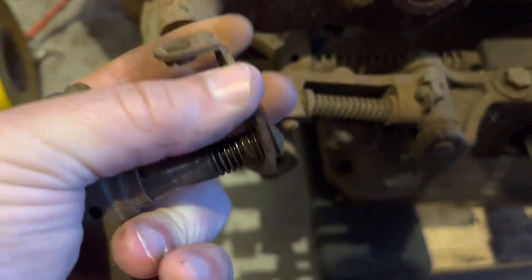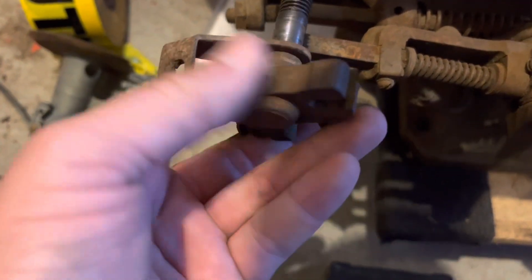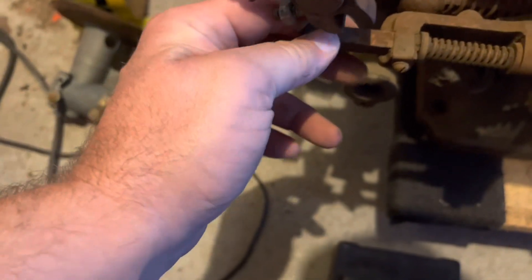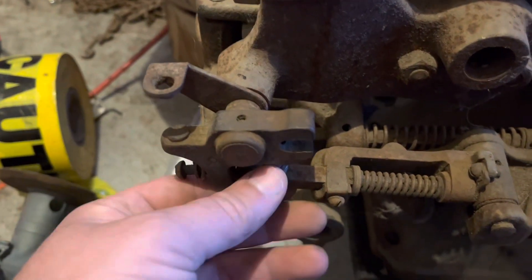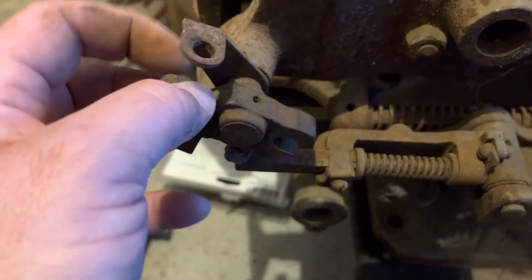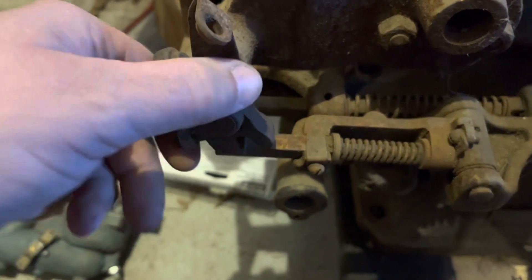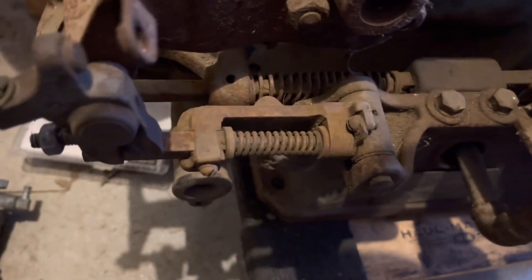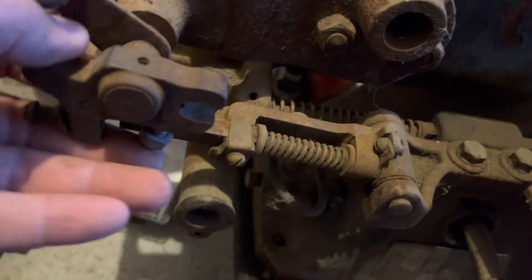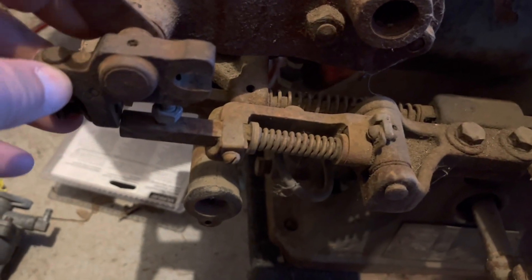This should go in like this. Now a spring would go between there — let me jam this in just to illustrate. This thing would be up here, a spring goes in there, and when this lever wants to trip it, it'll pull it down, applying tension on the spring so that after the thing fires it'll spring back. You can see how it goes forwards and backwards — when it goes back, that's when the mag fires; when it goes forward, that's when the mag is not firing. There's some adjustment on here to get that to work right.